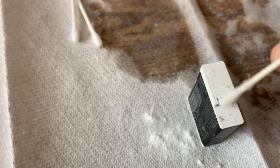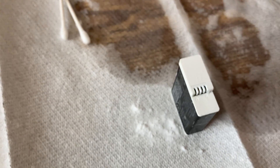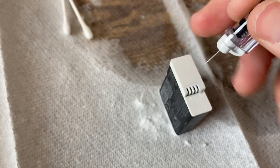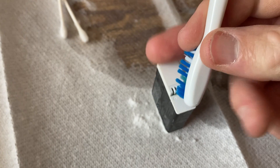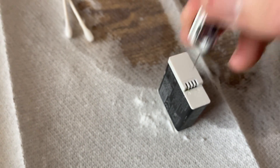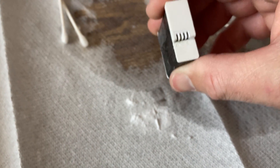After that gets going for a little while, take the toothbrush and just scrub inside there. I did that whole process about three times. Then take your alcohol, pour it onto one of your Q-tips, and use that to clean everything up. You can also use the clean side to dry it. Then take your needle or safety pin and very delicately get rid of any chunks or green parts remaining. Work on it, then get your clean toothbrush again and scrub. You might need to do more baking soda and vinegar, but you don't want it too wet — you want to stay mostly on the surface and not get it inside the battery. After you do that, it gets cleaned up pretty good.